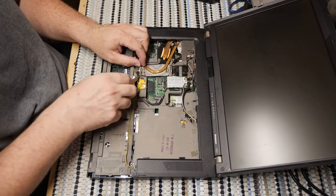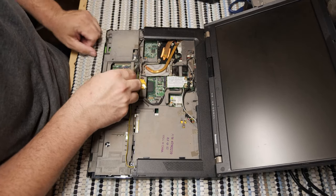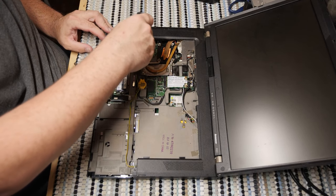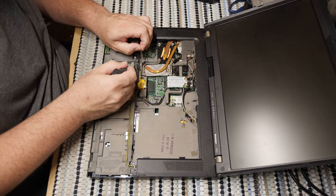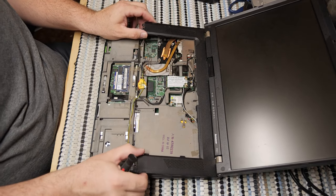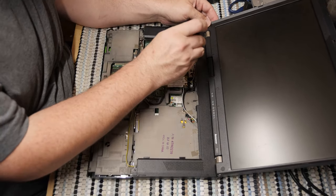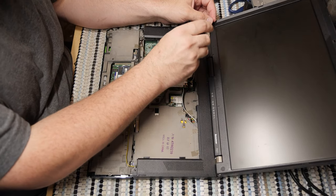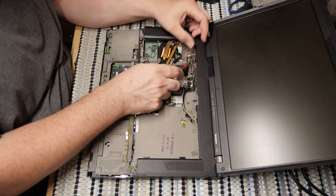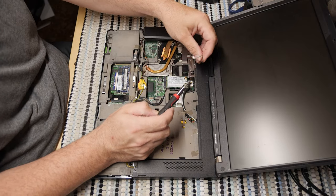Look, these speaker cords here, they merge into this one connector. So, well, there goes the whole ease of service thing. Once you're not doing RAM, Wi-Fi, or a dial-up modem of all things, the serviceability has gone out the window. So these speakers clearly go together. The metal that covers the CPU fan is there. I see another screw right here that potentially also is involved. The Wi-Fi antennas appear to be blocking it, so let's just go ahead and take them up.